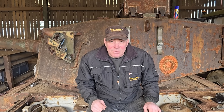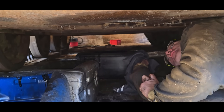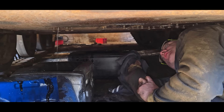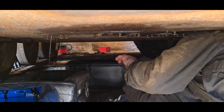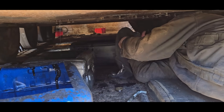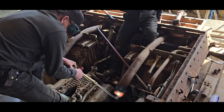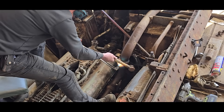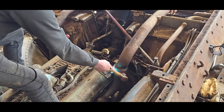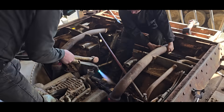More water than bloody oil — first thing to come out. I think the two tanks are linked, so I think I'm pretty much draining both. I took out 30 litres of water before any oil came out — a tad worrying. To get the tank up and running again, removing the decks is just the first part of the process. The lads now need to prepare the engine to be removed — removing exhaust pipes, unbolting the engine mounts, and disconnecting the clutch and the gearbox, all of which required the same amount of effort as the engine decks did, applying the heat, loosening and removing every bolt.